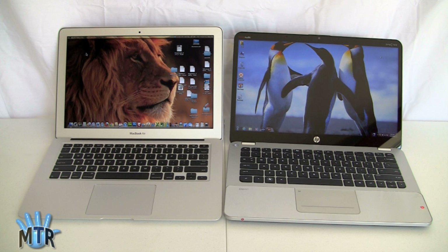While we're talking about that now, as I said, I love my Mac. This is my Mac right here, but as you can see, I am running Mac OS. I like Mac OS just fine, and that's the way I use it because Apple has really tuned the drivers and the operating system to work best running Mac OS. If you run Windows on the MacBook Air, you can lose up to 2 hours of battery life, for example, and you're at the whim of Intel's generic HD 3000 graphics drivers in terms of performance and less exciting trackpad drivers.